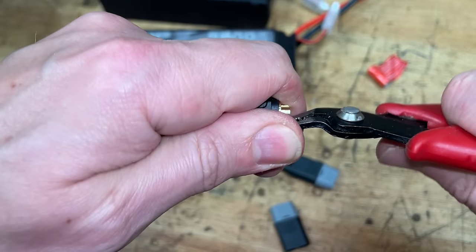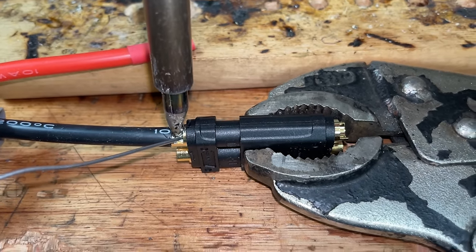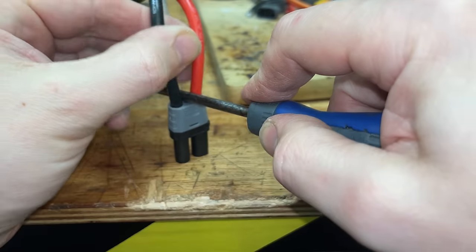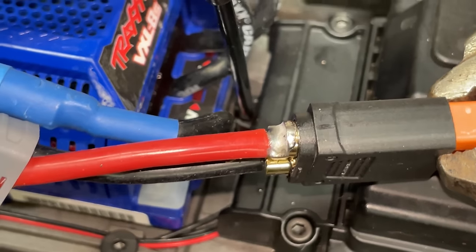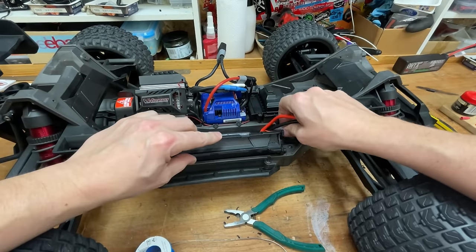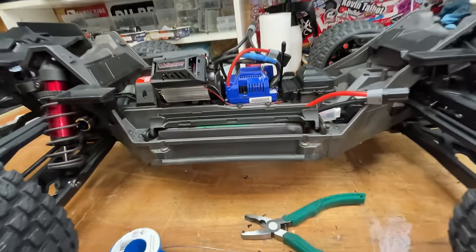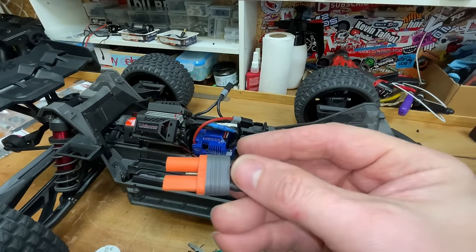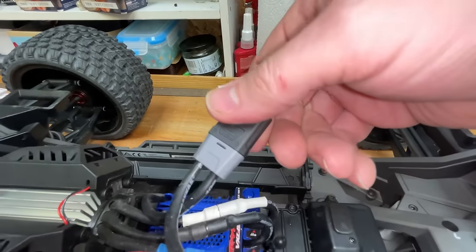So next up, I've got to solder some connectors onto the batteries. Now, these are the brand new Onyx connectors that I'm testing out. They're compatible with the IC5s and EC5s, but they hold together a lot better. The only thing that isn't fully compatible are the little pins in the middle, and I'm just going to go ahead and pull those out. Check that out. Those batteries fit in there perfectly. Now, on the EC5s, this little cover that covers up the cables does smash off when you're bashing, so I'm interested to see how the Onyx ones hold up.